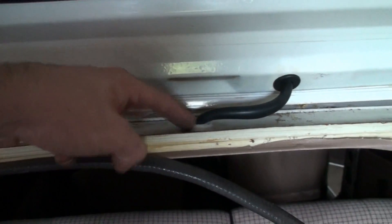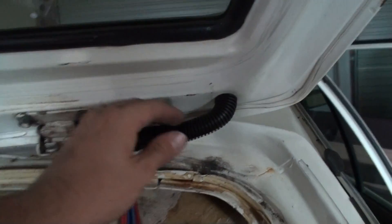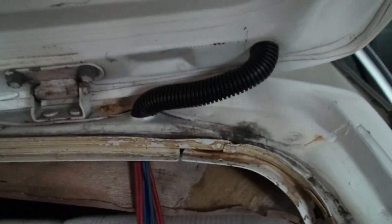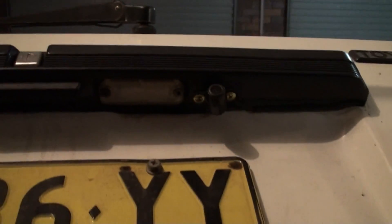Over here I've got some big split tubing for the zero gauge, crammed through about that much on each side so it'll stay in there. I've got the factory earth for the earth and the camera, and I've just tucked the leads up in there for now. If I build something later I might have to move them, but for now they're neat. Camera is installed using gold screws so they don't rust.